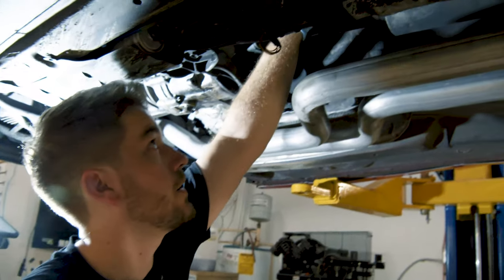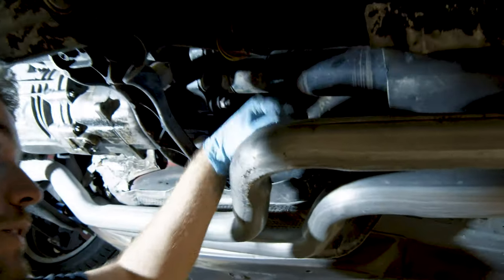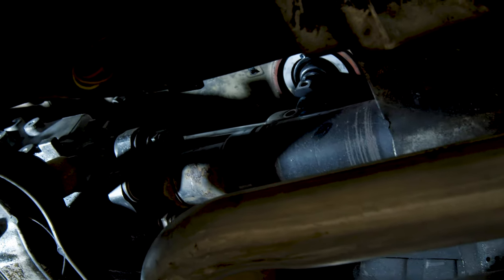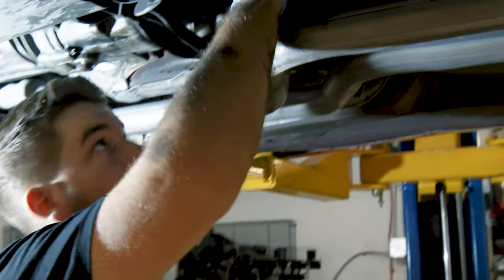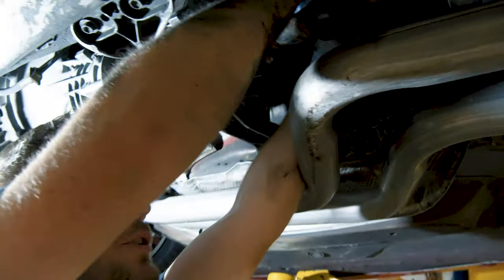We're going to push up our cover for the bottom of the dust boot cover, slip it behind the plate, then take an 8mm with an allen up top and start to tighten down the sides. Now with the shift boot and cover in place, we're going to install the back of the DSSR onto the shifter.